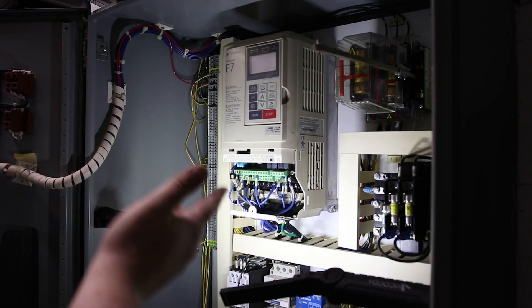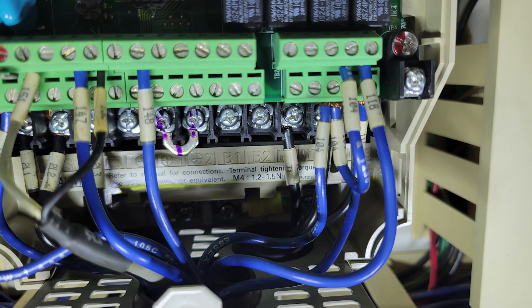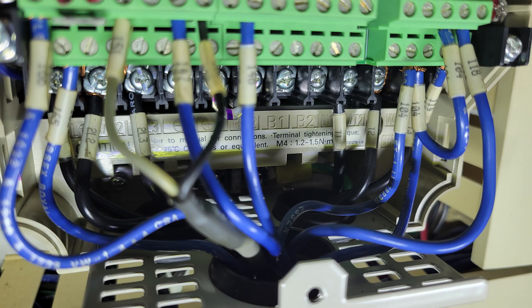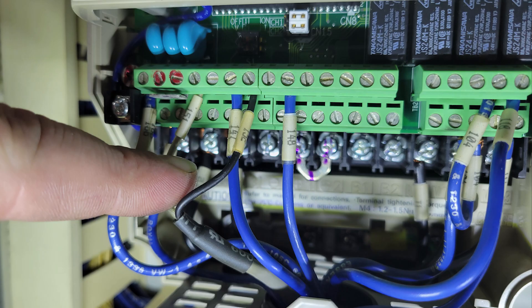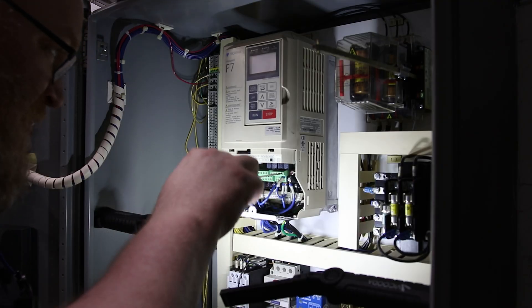I'm not sure if this is a problem, but we are going to be replacing it. The first thing is just take a bunch of pictures so that we know where these wires are supposed to go and try not to miss any. Check to make sure we ain't got voltage going in, because that would ruin your day.